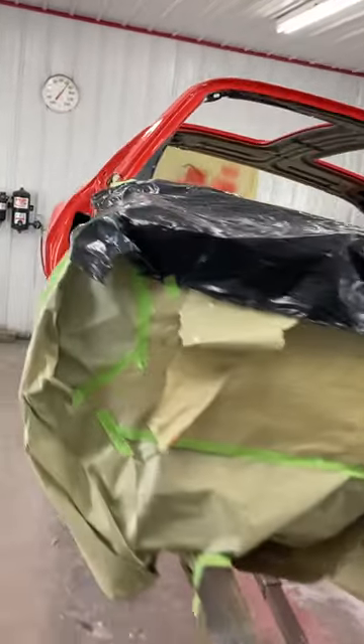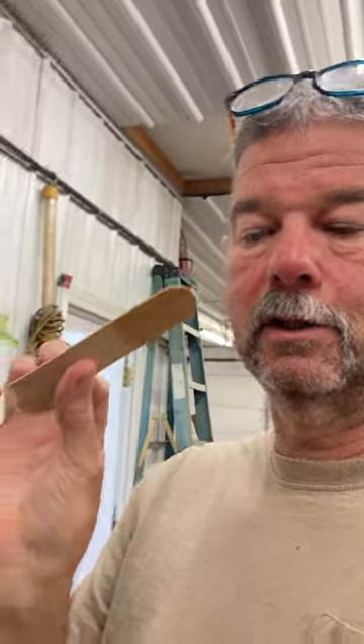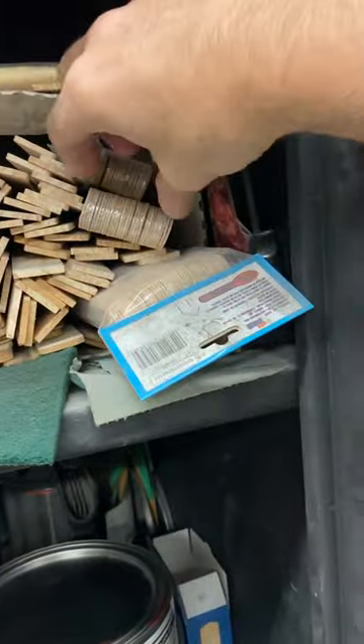All I'm going to do with the car is cover it up and put it back in the corner, build the frame, and then pretty much just build the car. After you put a little bit of clear in, you really have to be careful. I'll use 2000–2500 grit and just barely rub it. Go ahead and take a little paint stick — a small stick — and wrap some paper around that. I bought a bunch of tongue depressors; they're perfect for mixing small amounts of paint.